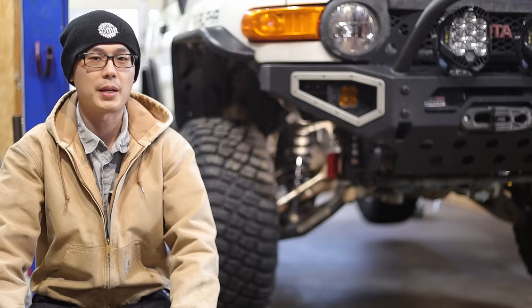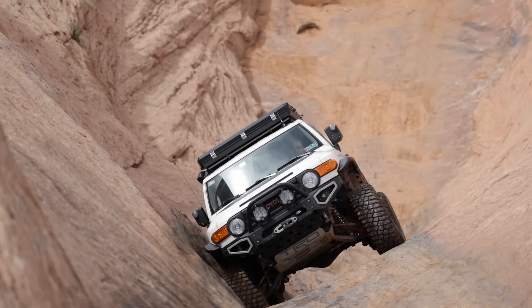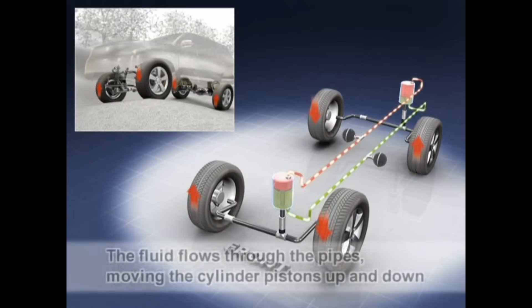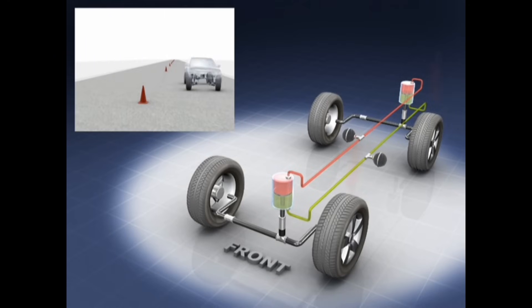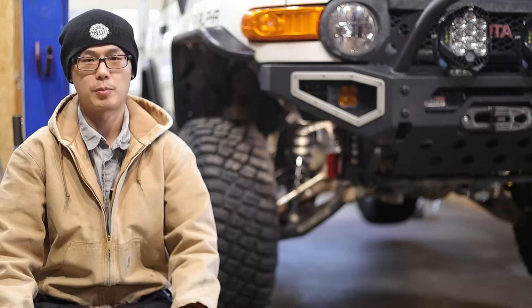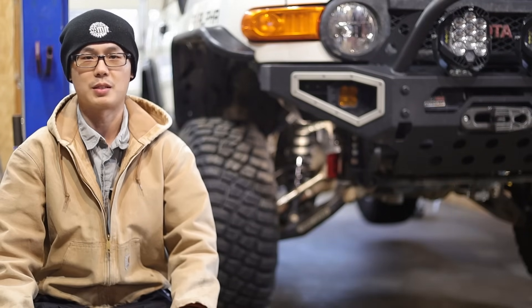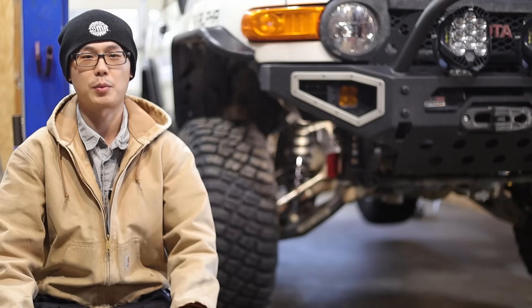Articulation is important, but there are many other aspects in off-roading. One of them is off-camber stability. I've been through several really sketchy off-camber situations and I wished I had my front sway bar installed. Looking at Toyota's marketing video for KDSS, it appears that if one cylinder is compressed, the other is forced to extend the same amount. When both cylinders are compressed or extended simultaneously, the hydraulic fluid opposes that, reducing body roll. By this operating principle, I thought KDSS should have better off-camber stability — but sadly, the reality was quite the opposite.